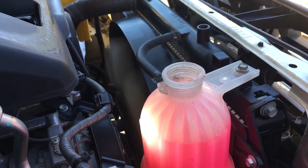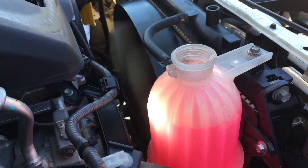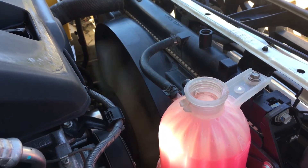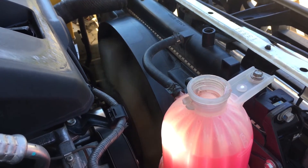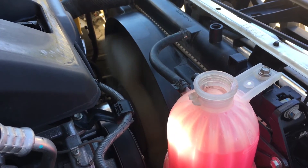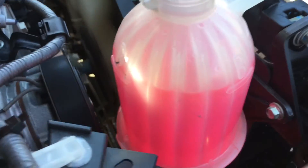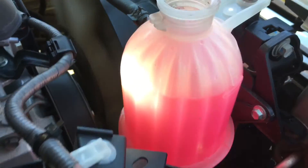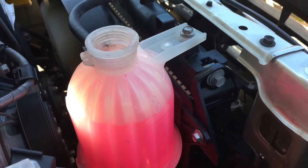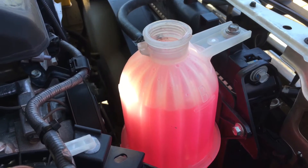The key is that you get the coolant in there initially. We're now at about eight and a half litres on this one. That's the statistics - I don't care what the book says, I can tell you what we're pouring into the engine. That's where the water pump comes in and we're staying above the B-line. If you put any more in there it would be wasted coolant - maybe about half a litre wasted. It takes about 8 litres.